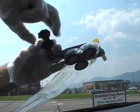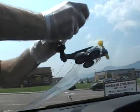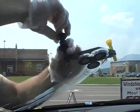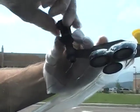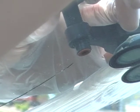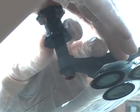Now we're going to inject it. Keep it shaded at this point — cover it with your hand. We're going to use about five to six drops of resin. We're going to do pressure — just turning the piston clockwise — you can see that O-ring stand up. Then go back to vacuum and back to pressure. I can already see it starting to go in. You have to look at cracks at an angle to see that it's filled; if you look direct on you're still going to be able to see it. You can also put just a slight amount of pressure on the injector to encourage it to go a little more — but if you push too hard, you can cause it to spread.